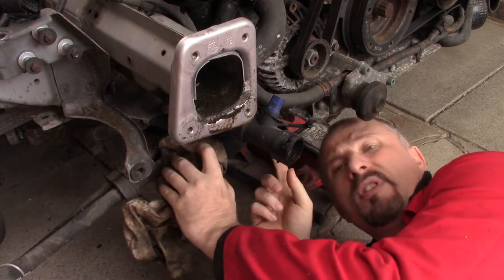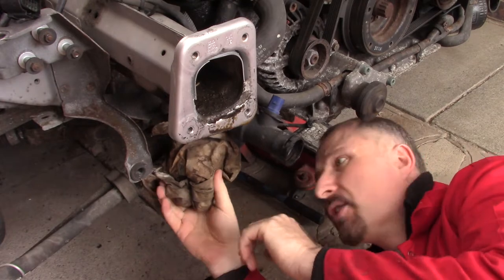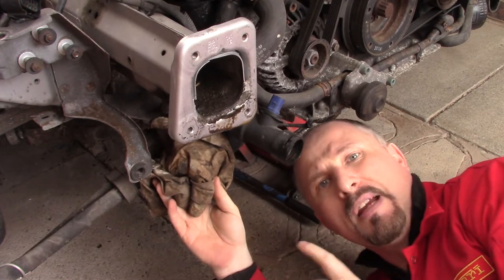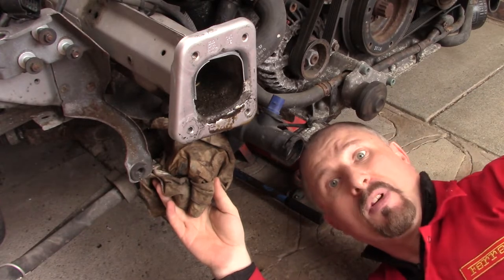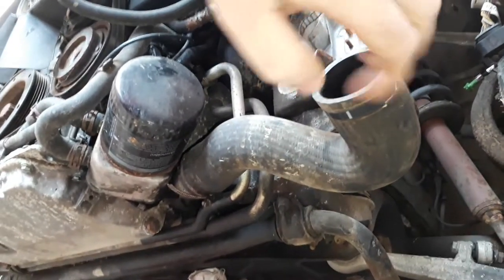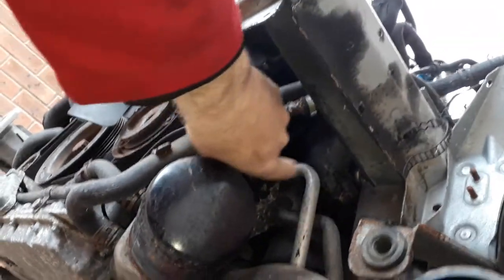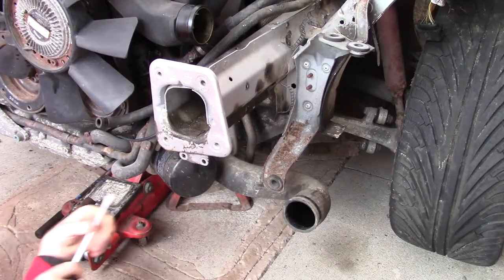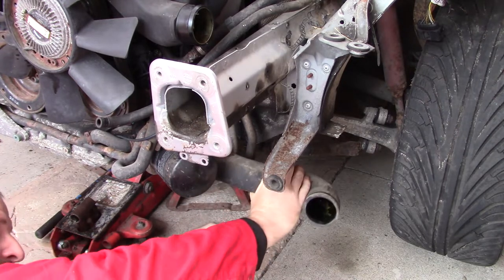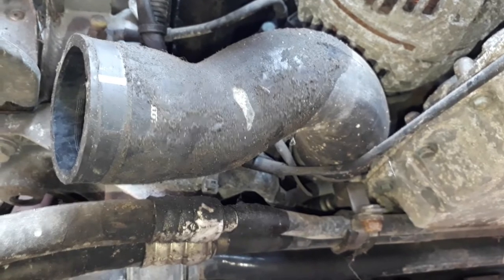Before I can undo the loom to the alternator, we've got a few pipes and hoses in the way. The intercooler pipe here - I think we'll pull this off and remove the air con lines as well. It's a little bit more difficult stripping this car down because I've got to keep thinking about where to put the camera so you can see what I'm doing. I'll just remove this intercooler pipe - there's a jubilee clip here - and this should give me a little bit more access to the air conditioning lines. I'll just remove the intercooler pipe from the other side of the engine too - there's a jubilee clip just tucked there.